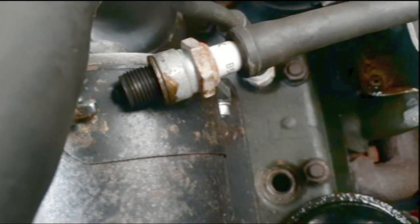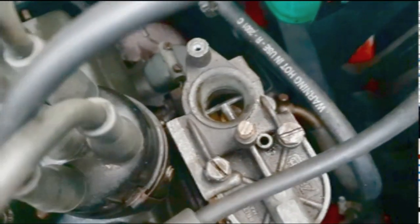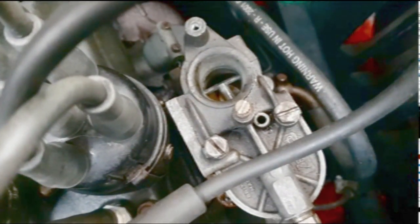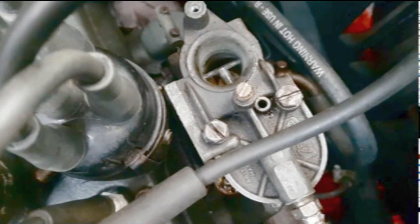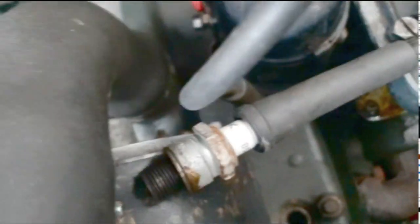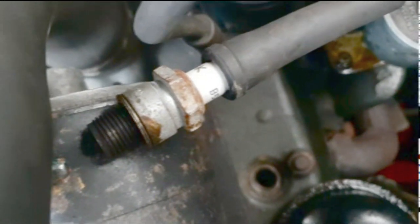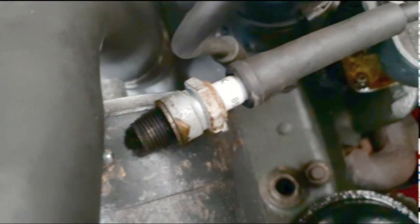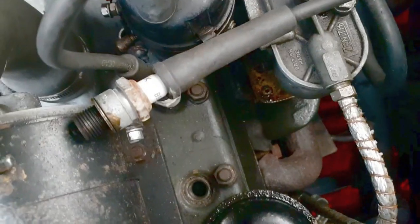What you can do on these carbs — you can pull the spark plug and see if the spark goes into the plug. I've taken the top off and poured some fuel directly in. The bowl's working so that would eliminate the pump, and still nothing. Let's see if we are getting a spark — ignition on. Yes, we've got a spark. So we're definitely getting a spark but that plug is dry. I don't think there's fuel getting there.